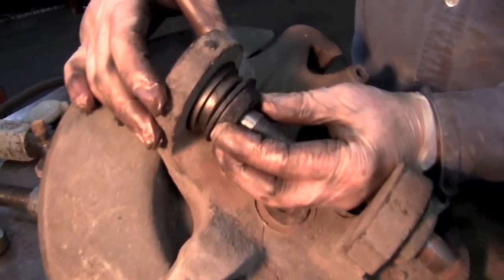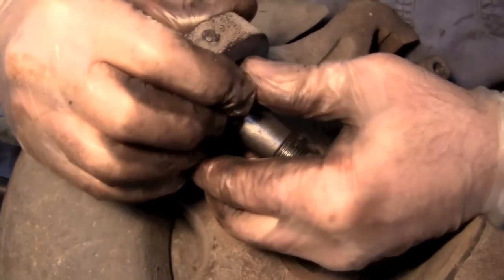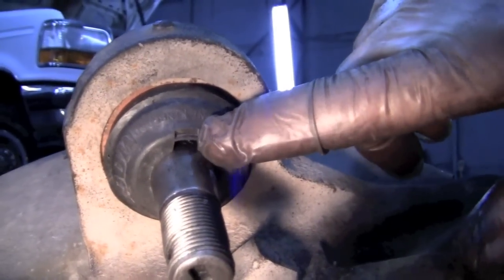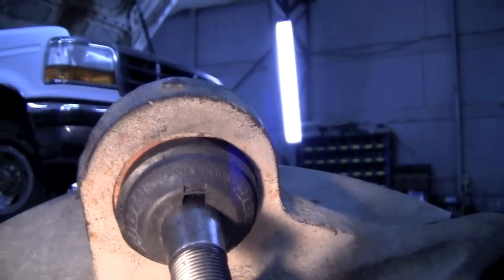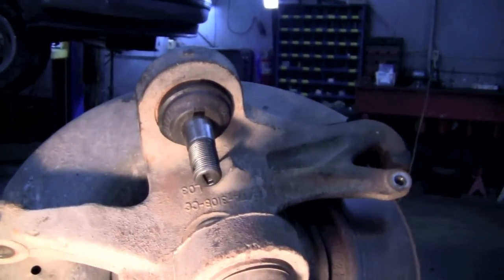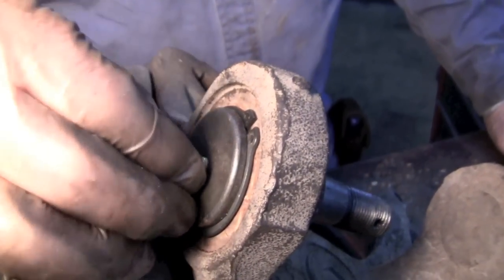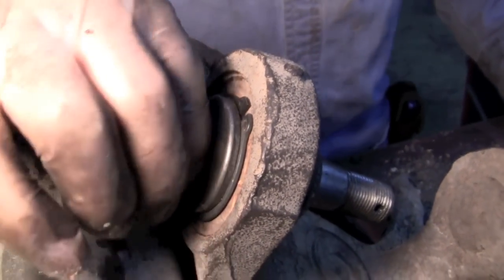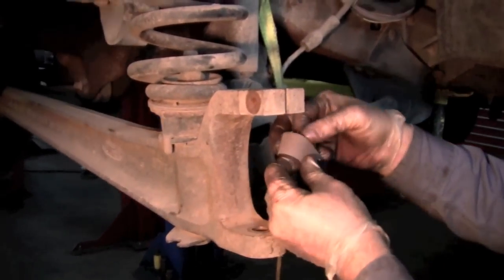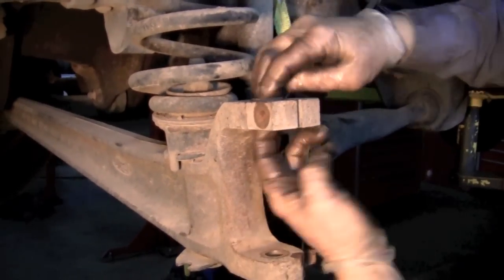The next thing we need to do is take the rubber boot and slide it over the ball joint. When you get your rubber boot in place, make sure that the little notch for the grease is actually pointing upward — but if you look at the knuckle, that would be inward when you actually mount it on the vehicle. The next thing to do is take the greaser and screw it into the bottom of the ball joint. Take the same piece of emery cloth and just try and clean out the inside diameter just a little bit — dress it up.